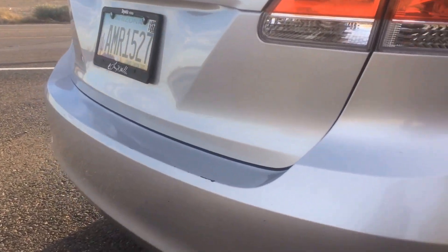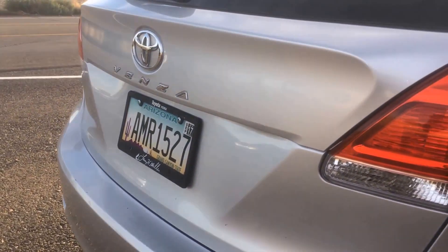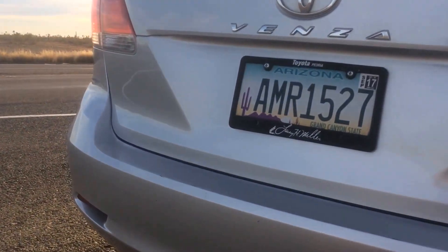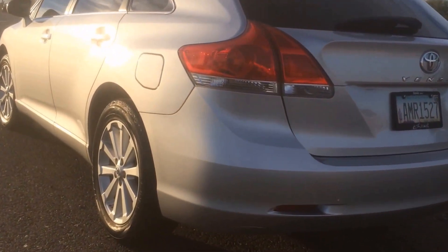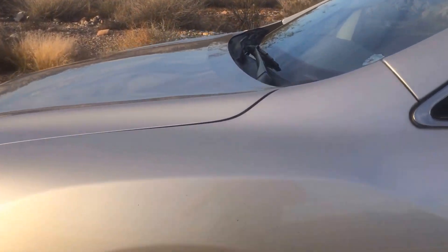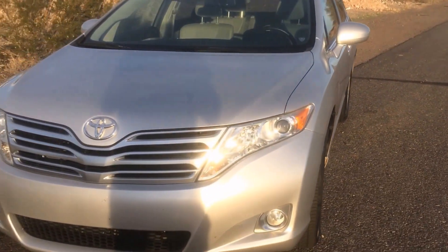Looking at the back and the other side, we're just matching up the paint and making sure everything's consistent. Catch a reflection and go from panel to panel around the car, because if one panel looks duller than another or is fading differently, that's a good indicator of accident repair. Going around the other side and following the sunlight panel to panel, everything matches up very well — including across the hood on both sides.